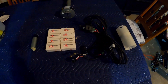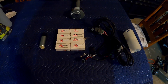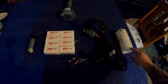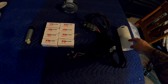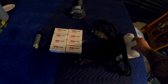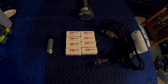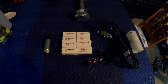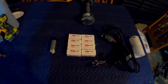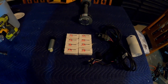The wiring harness from Racetronics — I believe they sell that online for $75 to $80. And then the modified bucket, which obviously comes with your car, so that's free. You're also going to need the black hose that comes with the bucket that attaches to the fuel pump. For a dual fuel pump setup it's a different hose you'll be using. This is a fairly cheap setup — you shouldn't be spending more than $400 to $450 on this entire thing.